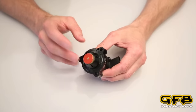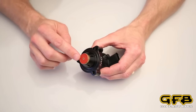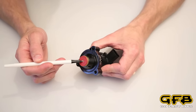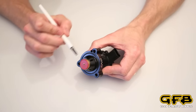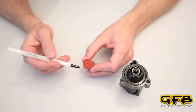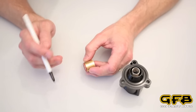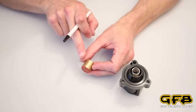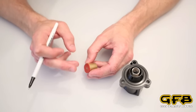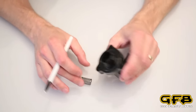Let's start with a typical example. You're driving along the road and you floor the throttle. You've got boost pressure at the inlet of the valve pushing on the face of the piston. However, air is also fed through this small transfer hole, which balances the boost pressure on both sides of the piston. The important thing is the area here is about 20% smaller than the area on the back of the piston, so that means for any given boost pressure there's 20% more force pushing it closed than there is pushing it open. So the piston is going to stay shut no matter what the boost pressure is, even if you remove the spring entirely.